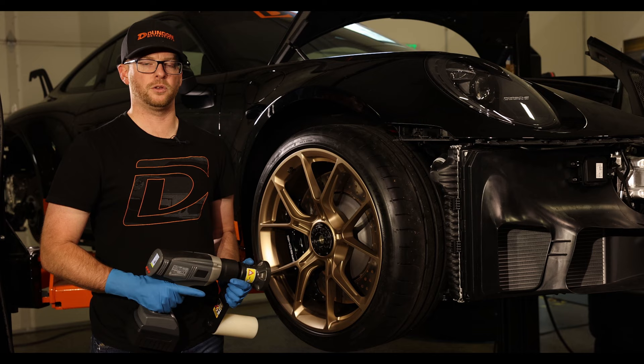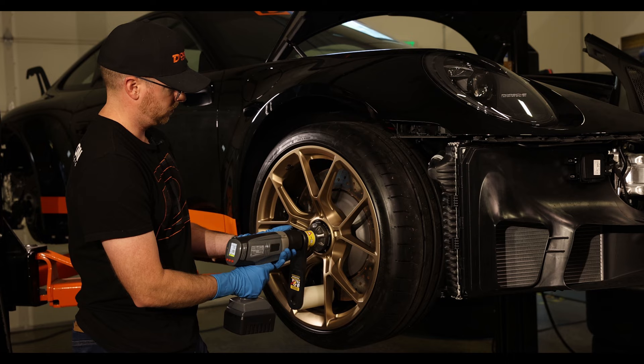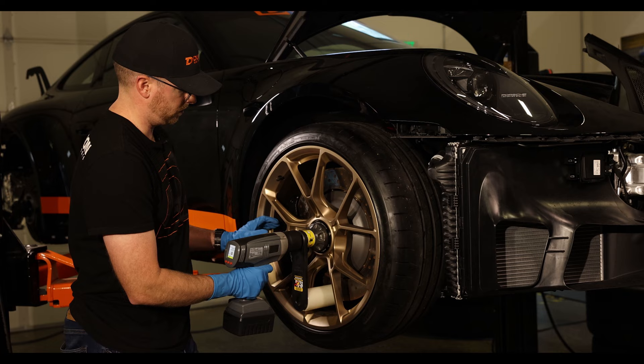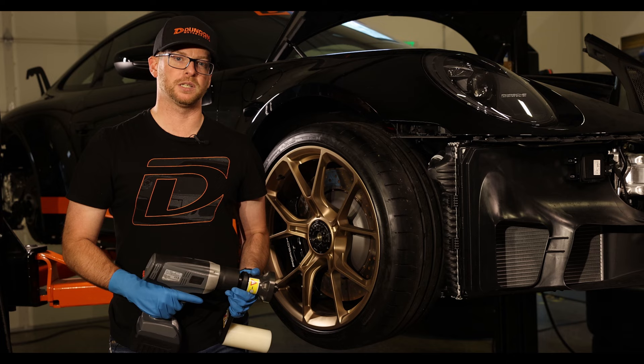So there's that initial torque value. The proper torque sequence to actually complete the job, if we're gonna leave this wheel on - we're gonna reinstall the tool onto the car and actually reverse the torque 60 degrees per Porsche spec. So we're gonna back that sucker off, and then back on. Flip it, squeeze, push the button. And now the wheel is actually torqued to Porsche specifications - you could put the center cap on and go about your business.